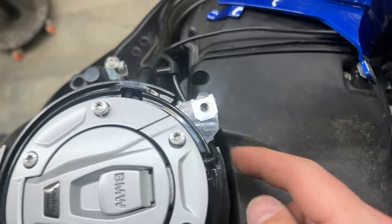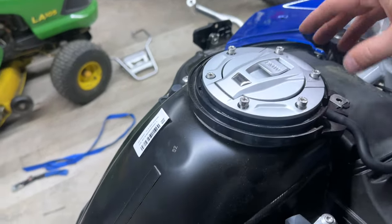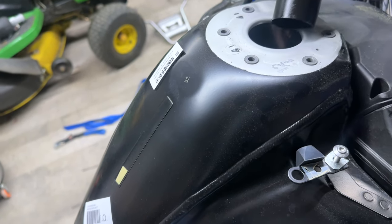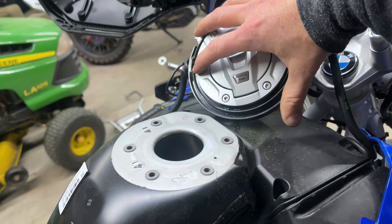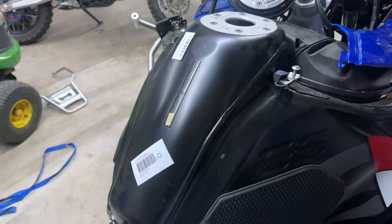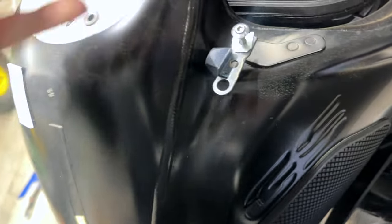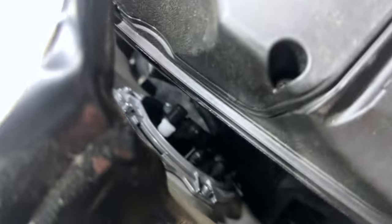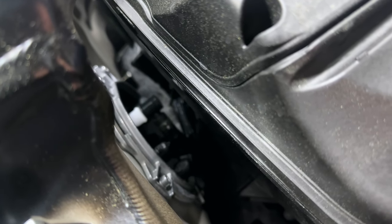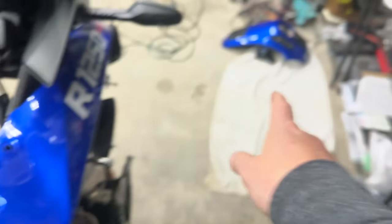I've also unhooked the T25s so this comes right off. You can unhook these tubes and the electrical cable — this is the fuel sensor, and these are breather tubes — but I usually just don't do it. I usually throw a towel in there and remove the tank like that. It should be dry and pretty empty. Rock the tank backward, slide it back a little bit to get it off the rollers down here. You'll see a couple of cables — looks like three on this bike: two sensors and one fuel line. They're all quick disconnects — remove those, and then you can take the tank off and put it onto a towel.